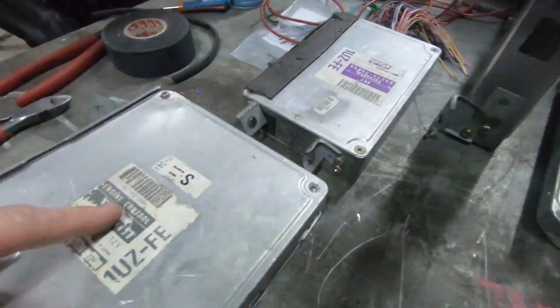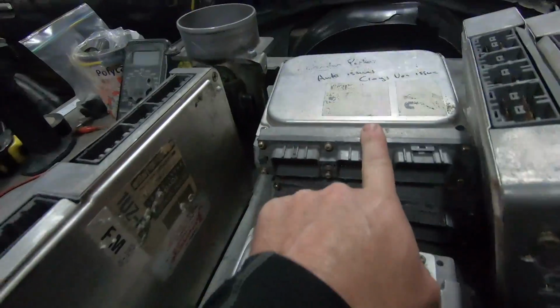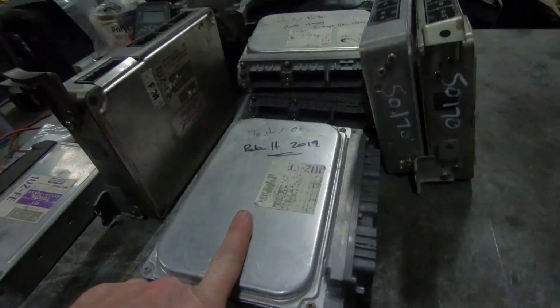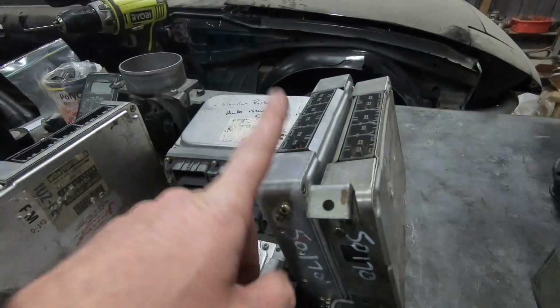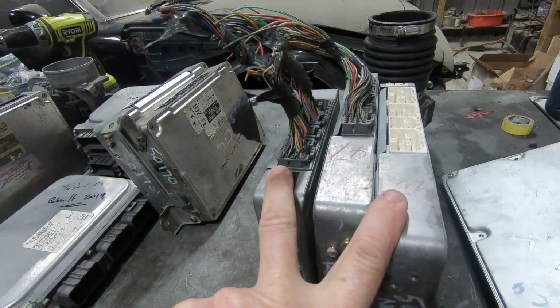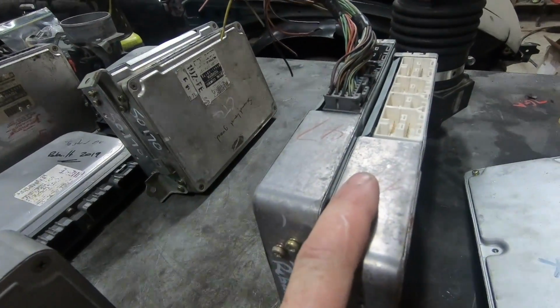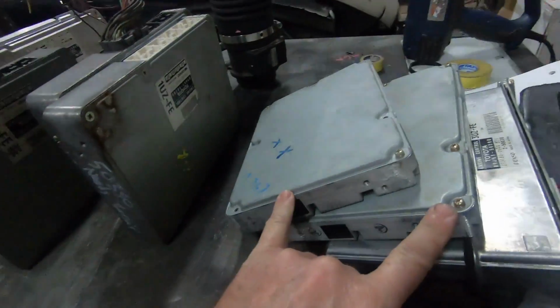These are Crown ones, early Crown, separate ECT. This is early Celsior, this is early Soarer, early Crown, the second generation, still UCF10 Celsior. This is 20 series Celsior. Oh wait, no, that isn't. That's a Crown. Those are UCF20 Celsior. So that's the Gen 2 engines. These are VVT-i's, and that's a 3UZ.